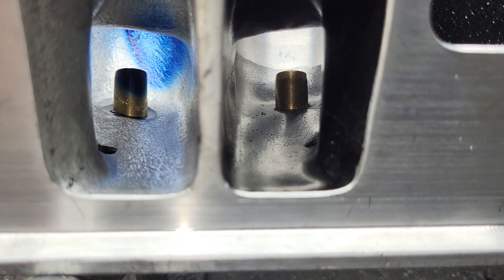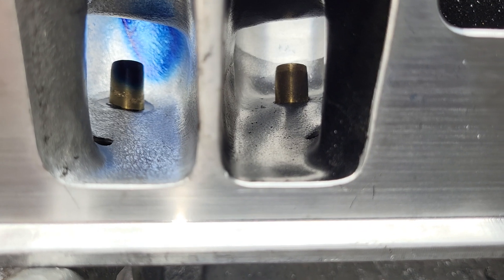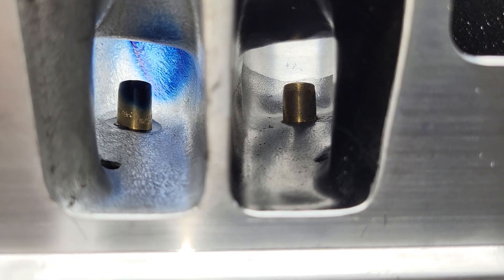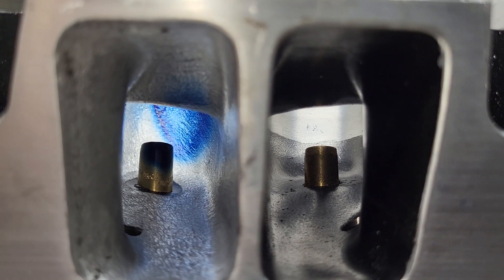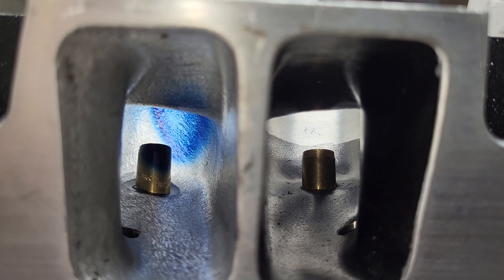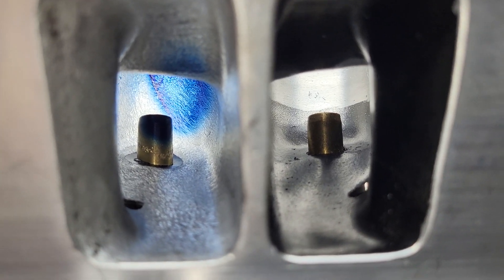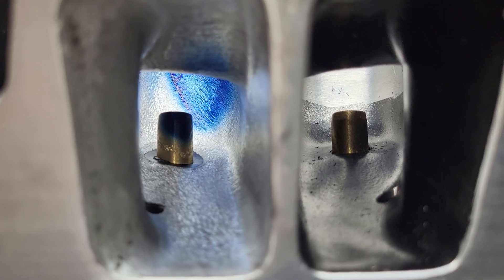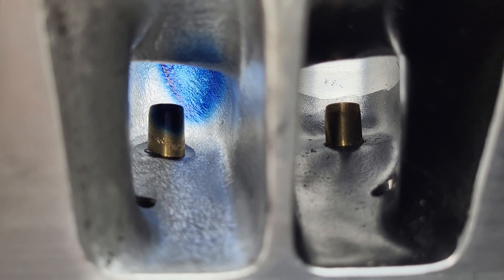The roof hasn't really had much metal taken out. On a street ride you don't want to make the ports too big — they're probably about 205 to 206 right now. The flow we've got is pretty good. These heads flow better than my old bow ties used to, and my bow ties were a handful on the 383. This is going on a 408 — it'll be a handful on the street.